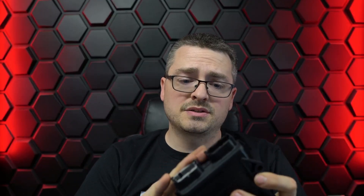The controller itself is inside of a water-resistant box. This is pretty solid. You've got a gasket in here, and then the box itself is hollow. Water could get in if you pierced a hole in it or something. But in general, IP67 — you'll be perfectly fine under the hood of a car, assuming that nothing's punctured or anything like that. This will be perfectly fine. And then you've got the two connections on the box itself.